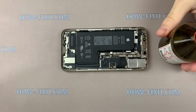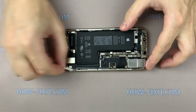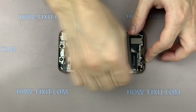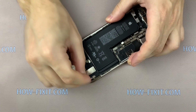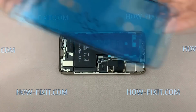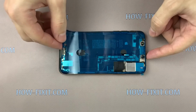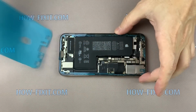Using medical alcohol, wipe the surface of the iPhone housing where all the tape was located. Now take new adhesive tape and apply it to the keys. With this tape you save the waterproof resistance of your iPhone XS. I left a link in the description where you can buy this adhesive tape.